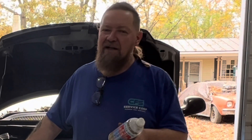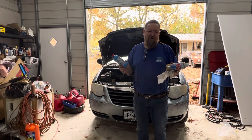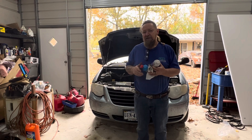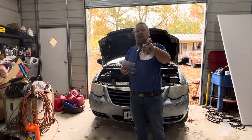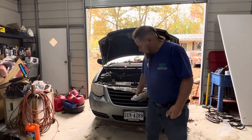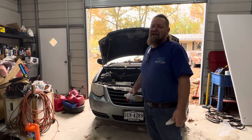It was rough. I don't like these front-wheel drive cars — you can't get to things. You've seen that the water pump actually had to break the fins to get it off, and I had to grind the tip of the water pump off to get the new one in. I'm not a fan. Someone said you need to drop the back of the motor and it gives you the room — hey, I'm trying to put a water pump on, not replace the motor. God bless each and every one of you. I'll see you next time on Fixin' Things. I think it's doing good — that's about the fifth warm-up cycle. I think we got it; we can go fill it up with gas.